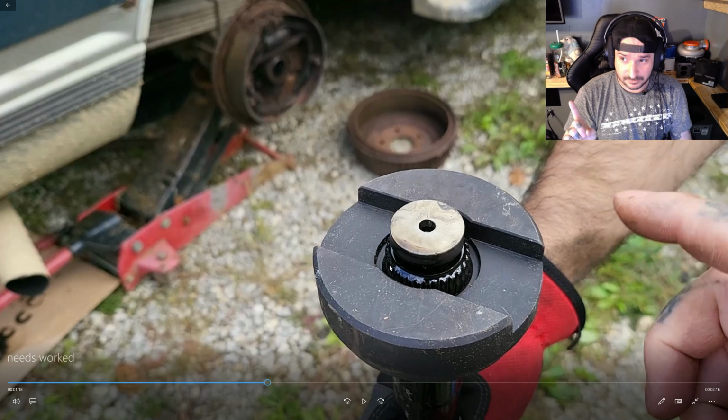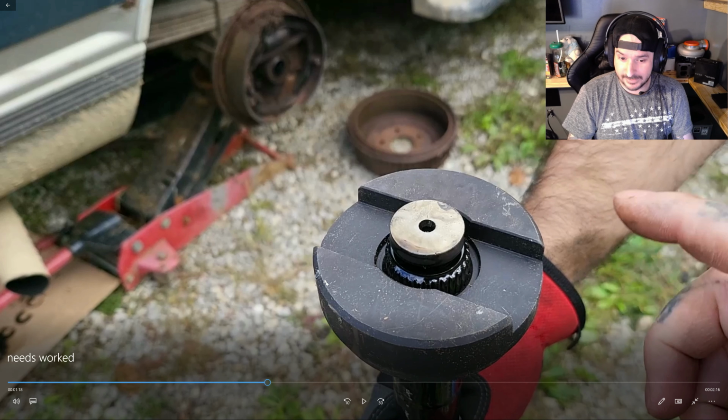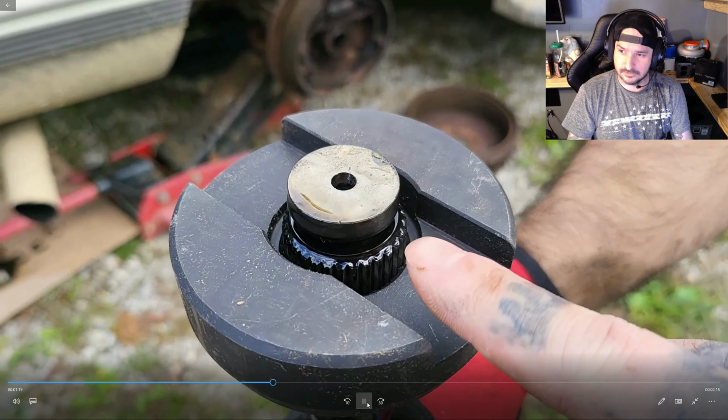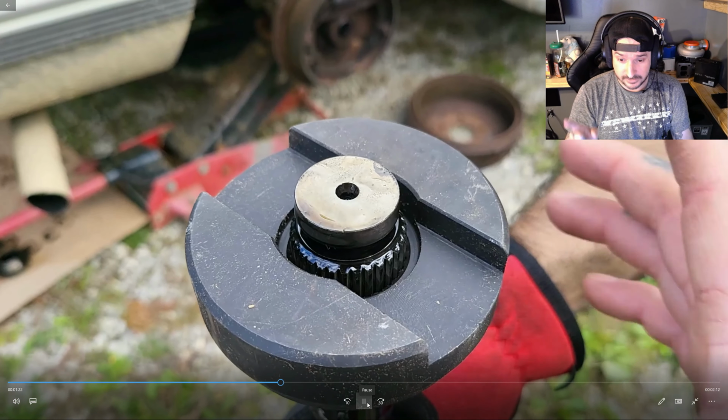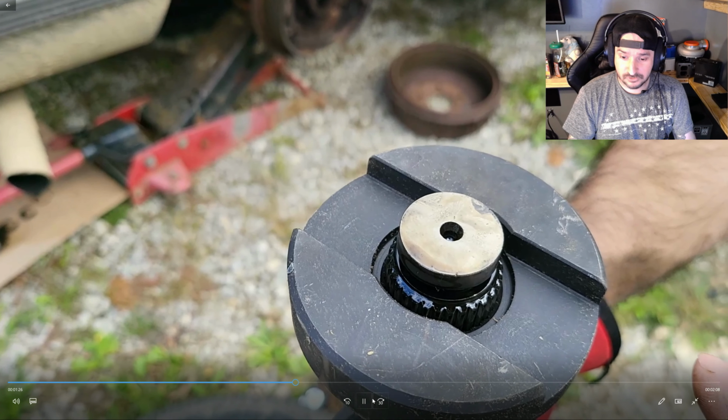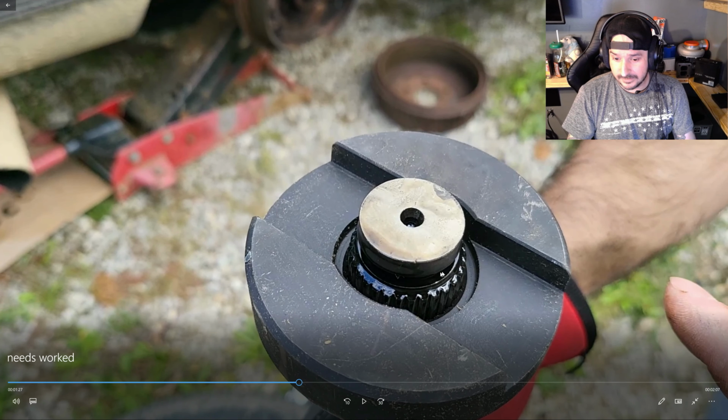Now there's another part we had to machine a little. So basically a belt sander. We took that off both sides. It was trouble. It's one of the worst mini spools I have ever installed in my life, and I've installed quite a few. It usually takes maybe 30 minutes to an hour if you take your time, goof off, just enjoying yourself. This took 9 hours to do, guys. 9 hours, just because of test fitting and other stuff going on. It shouldn't have been that way. And if you look, you can see the groove for the C-clip.